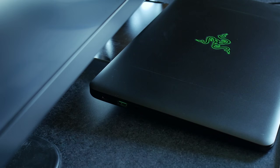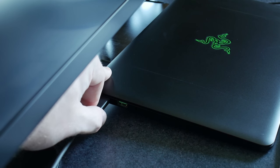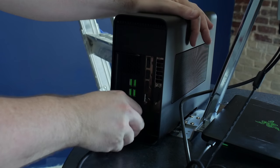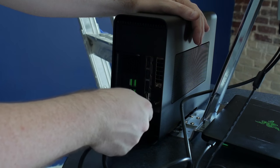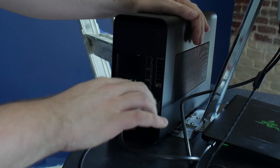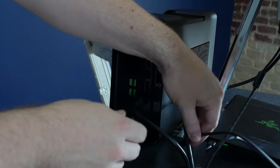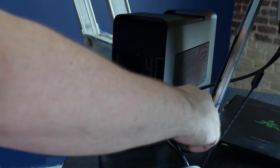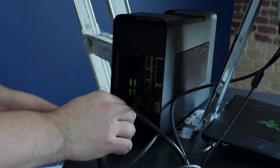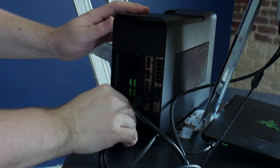Now, the USB Type-C port on this particular laptop, because it integrates Thunderbolt and because of all the other features, you can run DisplayPort, you can run Thunderbolt, you can run USB, you can run the charging. So when you charge your laptop, this is up to a 100 watt port. So a charger can dump 100 watts through that tiny USB-C connector. And actually, if you're using the Core, all you have to do is plug in the one Thunderbolt connection, that's it. And that one cable charges the laptop, carries the PCI Express connection, the USB connections are on the Core docking station, pretty much everything.